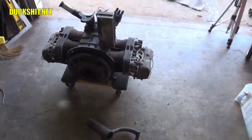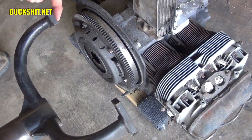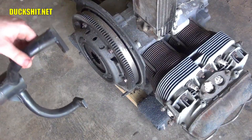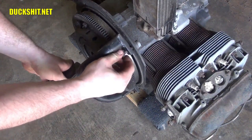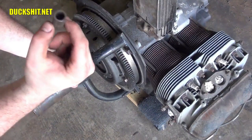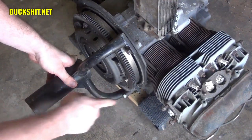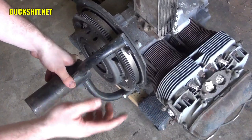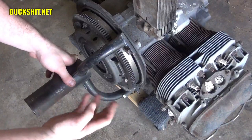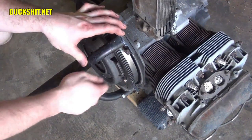Put the yoke on first. To attach it, it's real simple. We want to attach to the left side of the engine. On the wings of the yoke there are two holes. Take one hole and put it right over the studs on the engine at the bottom. Take the bolt and shove it through this hole and thread it right into the case. Then take your spacer — the spacer goes over the bottom stud — and put your nut on next. The spacer is optional, but it makes it a whole lot easier because you only have to turn that nut a couple of turns to get it tight. Without the spacer you've got to turn it 30 or 40 times. These are typically 17 millimeters — just snug them up, and that gets you started.